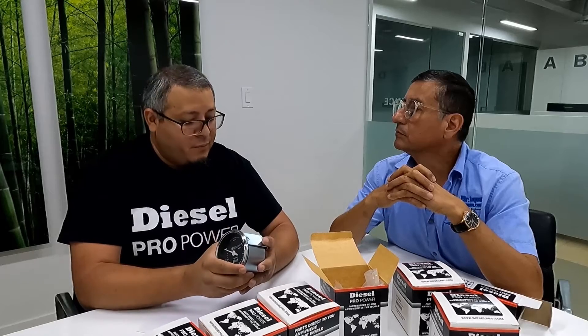You can use a mechanical device so you can read two different frequencies, or you can have two different readings for the engines — that's pretty much the main function. This is very important: it's about the material — it's marine-grade material. Those instruments can work outside or inside the engine room. They are designed for a marine environment and comply with the recommendations of ABYC and other standards regarding quality of materials: stainless steel series 300 and aluminum series 5000 for the brackets.